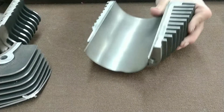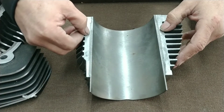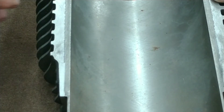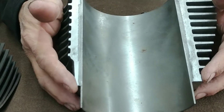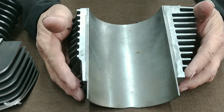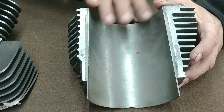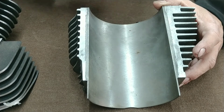This is also another brand, and if you look carefully right in here you can see there are little grooves back and forth, so that also has a little bit of air pockets. This cylinder as well is off-centered to one side. Being off-centered makes a difference when your rod is going up and down, trying to keep the piston in the center of the cylinder and the piston in the center of the rod. This is going to create a little bit more drag and more wear on the cylinder, and also create more heat.